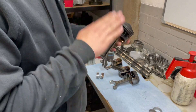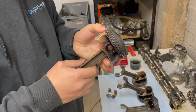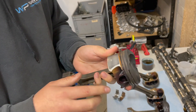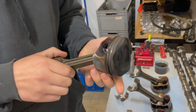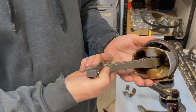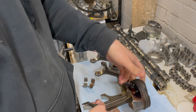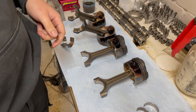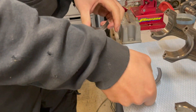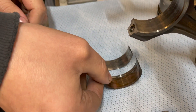Moving into the pistons - these are a hyper eutectic piston, very strong in design. When you get a clean one you can see they have a thermal coating on the top and anti-wear coatings around the side. They are a pretty strong piston with plenty of people running over 300 horsepower on these. The weakest point is probably the rods - these are powdered metal hot forged rods; they're strong, but not as strong as the pistons. You can also see here the cylinder that smacked the cylinder head - these bearings are chewed through.